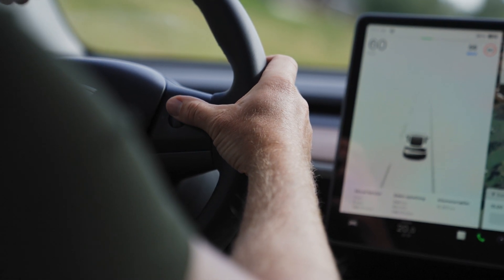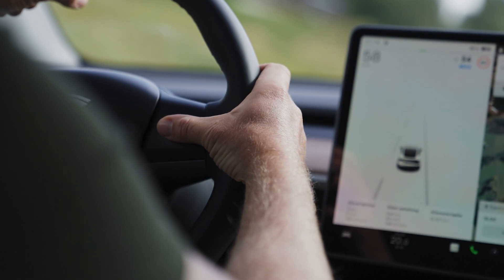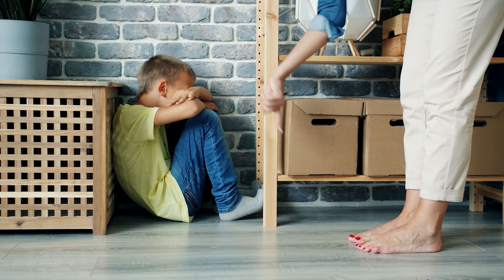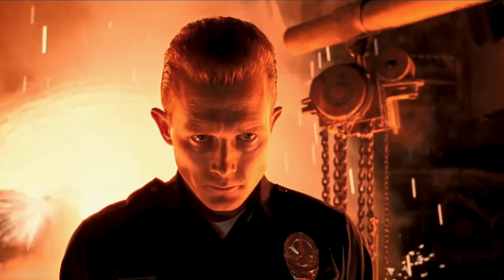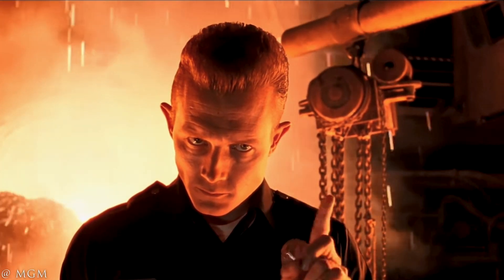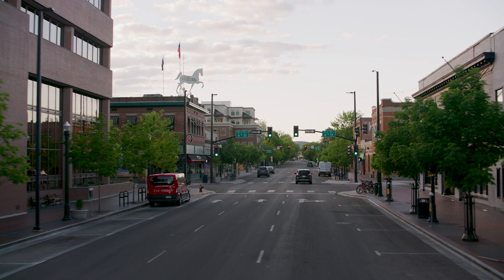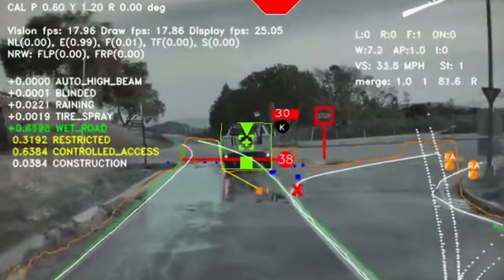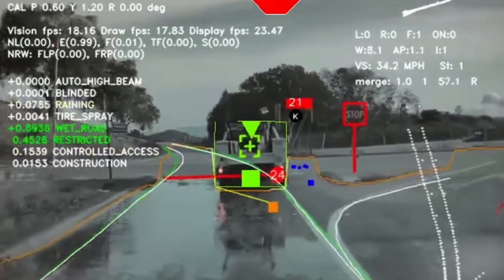Dynamic calibrations are driving calibrations without targets while using a scan tool. Just like a static calibration, the concept is similar to how your parents taught you right from wrong or where you were and were not allowed to go. This is not to be confused with programming. When dynamically calibrating something, you are telling the ADAS module where it is in relation to the vehicle and where it is okay to look during the drive.